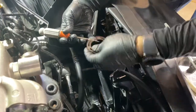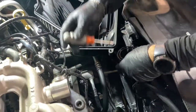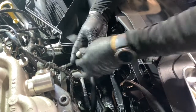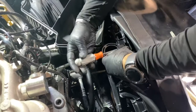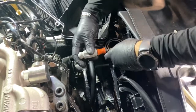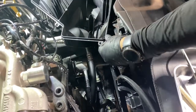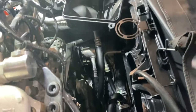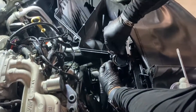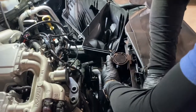Now, when you actually install the bracket, you're gonna wanna put it back right side up. So then you won't see the screws. And it'll be a clean install. Make sure that it's mounted solidly, it's not loose or anything. And now we're ready to attach the catch can. So you'll see the holes in the top of the catch can. You can get those both started and grab a Phillips and tighten them down all the way.